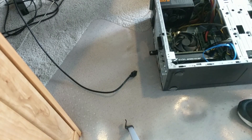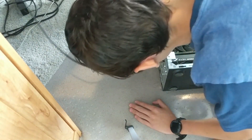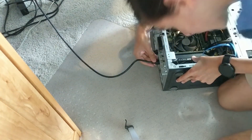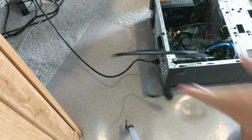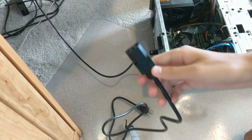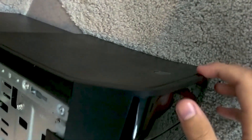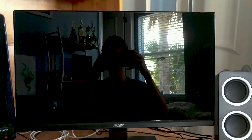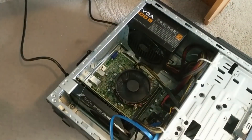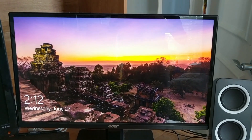Make sure that you're plugging your monitors into the graphics card, as opposed to what you were plugging into before which is the internal graphics. I'm going to use HDMI because my monitor uses HDMI — just plug that into the graphics card like that. Now I'm just going to plug in the power cable that came with the power supply, and hopefully everything will work. Everything is plugged in, the fan is spinning, and we're booting. There we go — it's booted just like normal, which means everything should be working.